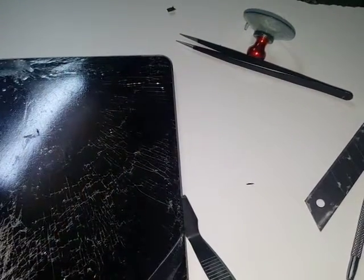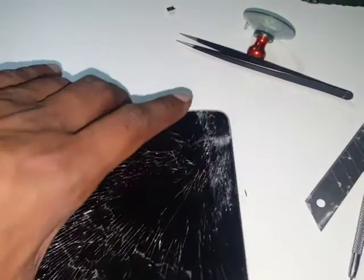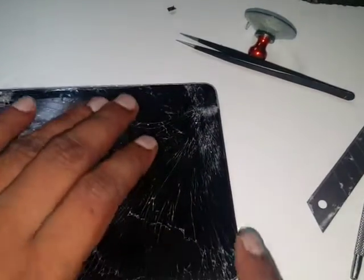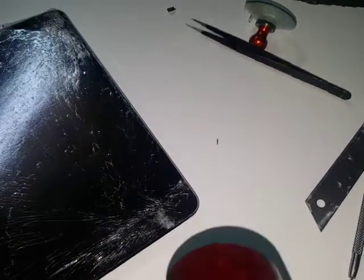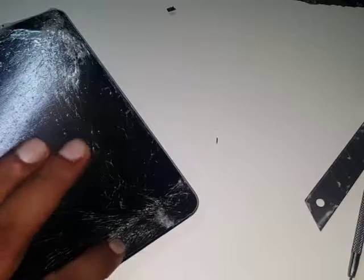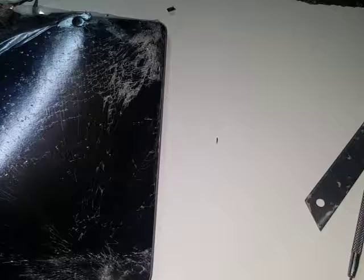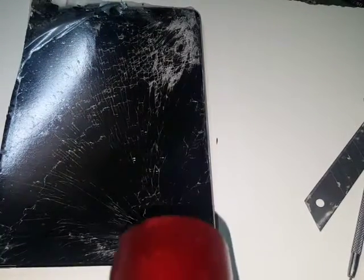I'll pause here — I don't want to waste your data and time. So far it's gone quite nicely. There's a camera on top here and it's quite long to open these things. I'm pausing the heating process to explain: only heat the area you need. From the borderline down it can damage your LCD, so heat evenly.